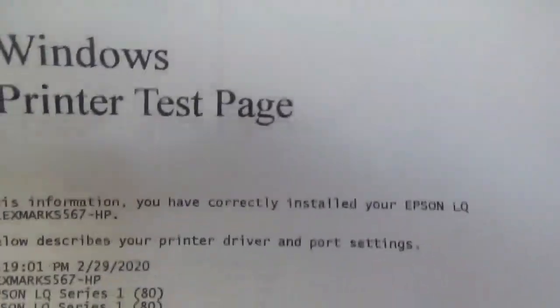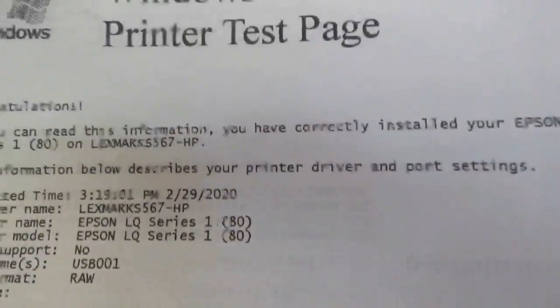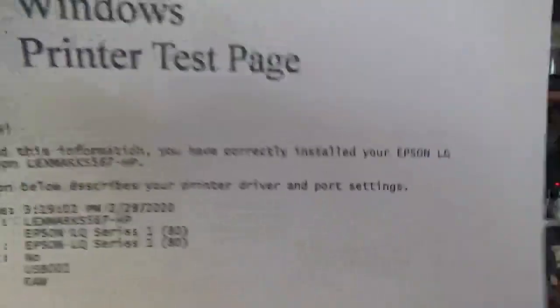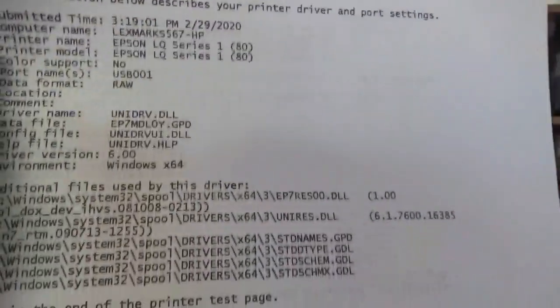What do you expect for a 10-pack of ribbon for 5 bucks, or 5-pack for 10 bucks, whatever it was? All from China — it's going to be lower quality, but it's the best I can do. For novelty purposes, it's not like it's going to be my everyday printer anyway. But you know, novelty of it. So there we go — successfully installed in Windows 7 using a parallel to USB adapter. Just had to set the port to USB 001, and now it's running.